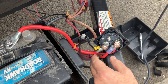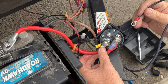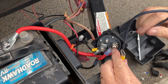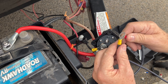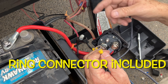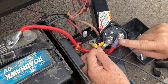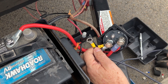The other thing I want to show you is this little connection here requires its own dedicated negative ground. This thing won't work unless that negative ground is taken care of. What I did was make a small dedicated cable to go from there back to the battery. They supply you with ring connectors so you can make one yourself. The main thing is: your positive is interrupted at the switch, all positive connections must be there, and there must be a negative here for the display to work.